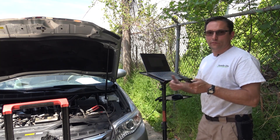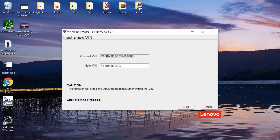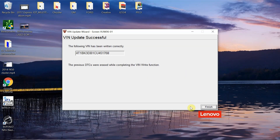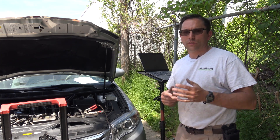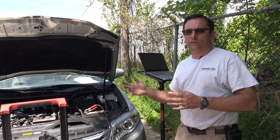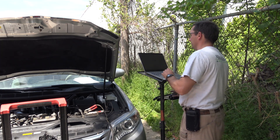At this point I'm going to go ahead and type that VIN number in. This VIN update software is available directly from Toyota when you have an active subscription to TIS — you can download it. It says the following VIN has been written correctly, so we're going to click Finish. Now a little tip: if you search for the keyword 'immobilizer' in Identifix, you might get misled. If you use the keyword 'registration' in Identifix, you'll be on the right path.